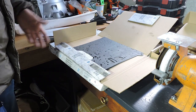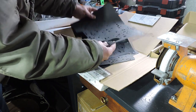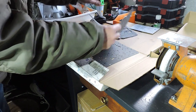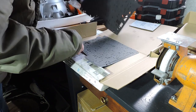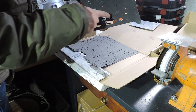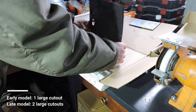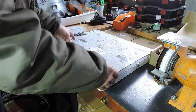The first thing to cover is valve body gaskets. On the 5 HP 18 you have two types: the later model gasket has two cutouts as you can see here, while the early model valve body gasket has only one cutout. Depending on the valve body and exact version you have, you need to use either the early or the later one, though I've heard you can always use the later one regardless of valve body type.